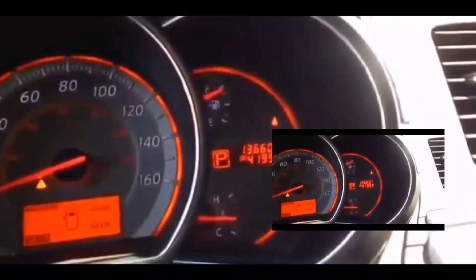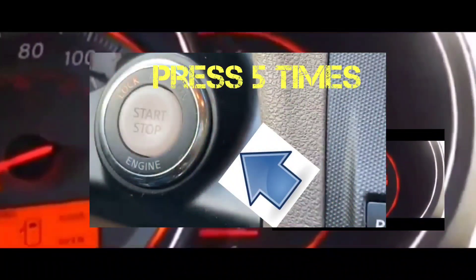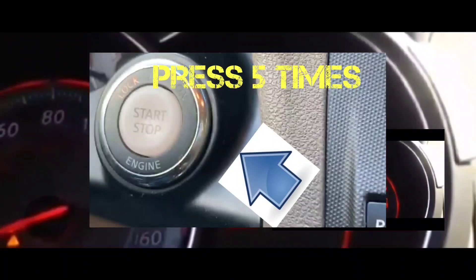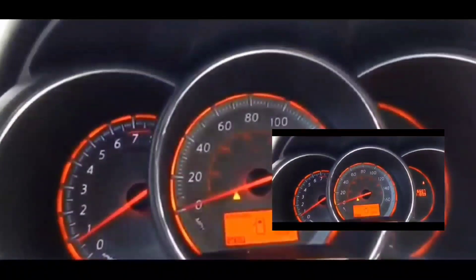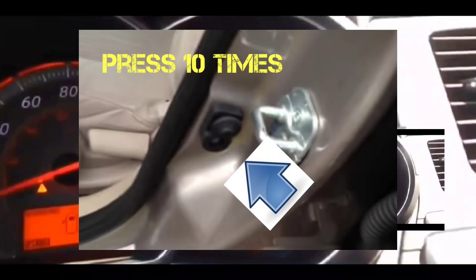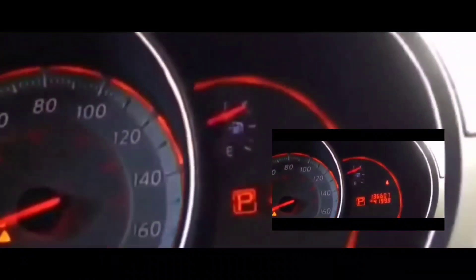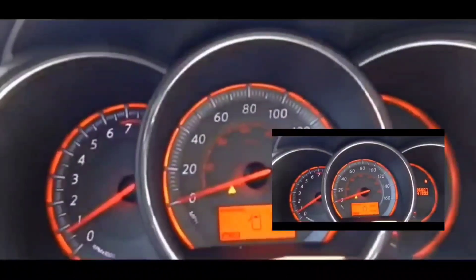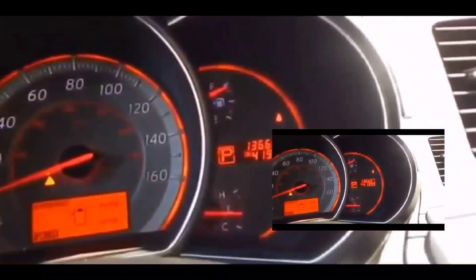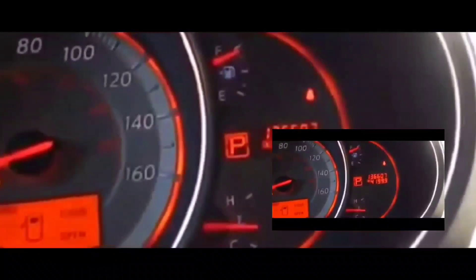You're essentially going to press the push start five times — one, two, three, four, five. After doing that, you're going to push the door button ten times — one through ten. And then after that, you're going to push the button three times — one, two, three. Right after that, your lights are going to go on and off, you're going to hear a couple of honks, and you're going to hear the blower motor going full blast on the low setting.